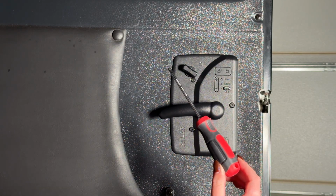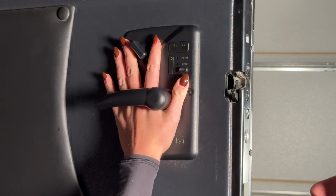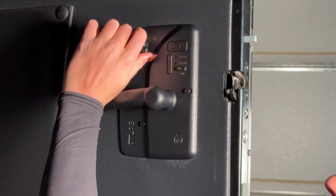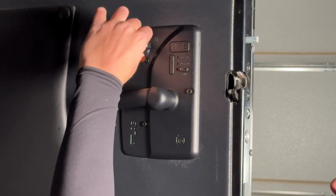Loosely secure the handle with the 3 interior portion screws. Do not use a power tool. Align the handle with the door cutout and ensure that the deadbolt is centered with the cutout in the strike side of your door. Cycle the deadbolt 1 to 2 times to ensure it's properly mated with the exterior portion.